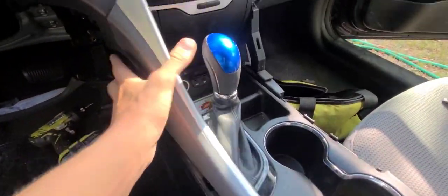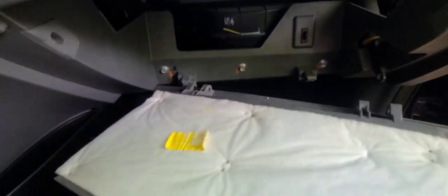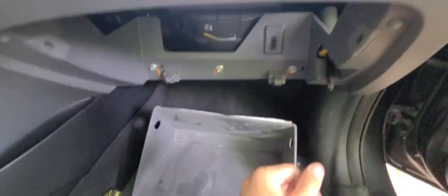These two pieces right here you just pull out - held in by clips. Go through all the screws you see behind it. To take the glove box off, it's held in by two hinges with plastic pieces inside them and two plastic caps in the holes on the sides, then it just comes out. On this side we took the cover off and removed the bolts. This bottom piece has to come out before the vents can come out, or else you will break them.